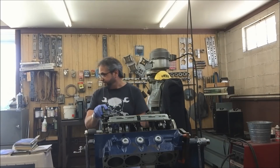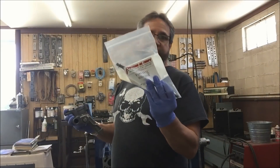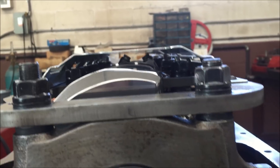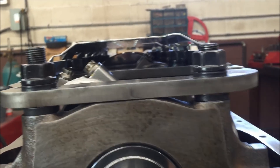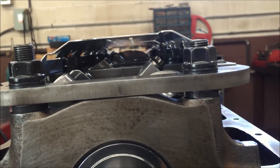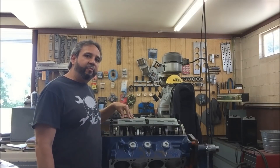Here's the oil pump pickup — that'll be perfect. Thanks, Doug. I also have the driveshaft. We're putting the windage tray on and trying to get it so you can see the clearance. It clears perfect. So I got the windage tray all on and tightened down with the Loctite on the bolts. All the clearances are golden, especially the pistons that were hitting the crank before — there's plenty of clearance now.